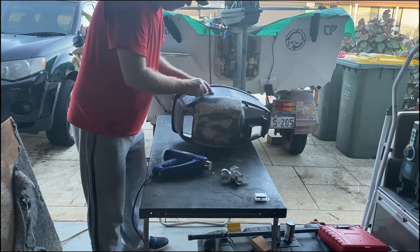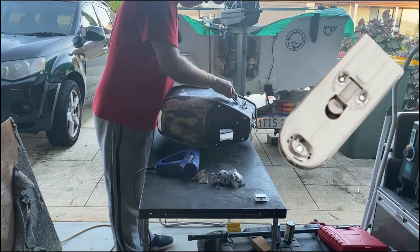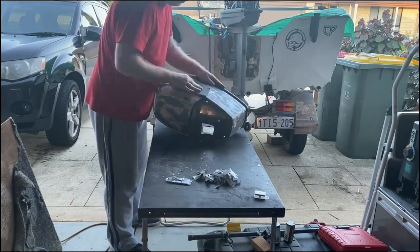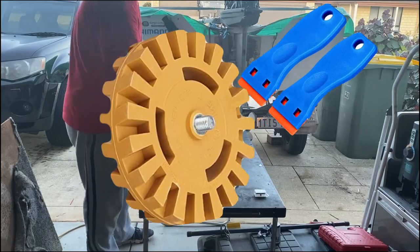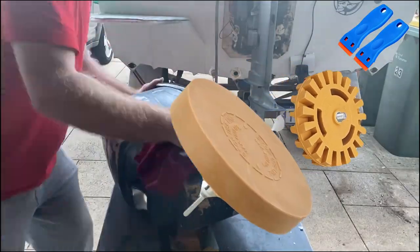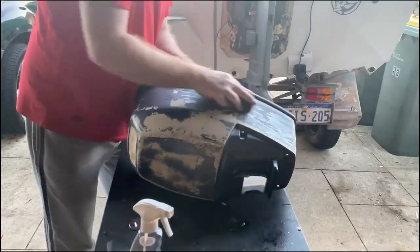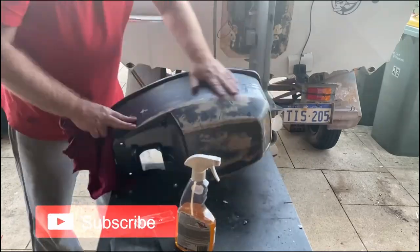The first thing you have to do is actually remove all the decals. Here I just used a bit of a hot air gun and a metal scraper and it took it off in seconds — the quickest way to go. Here are three other tools you can use: a plastic rubber scraper, a fluted caramel wheel, and a standard caramel wheel. The last two are quite expensive, about $50 each, so I would go with the rubber scraper, or like I did, the metal scraper was easiest. The spray I'm using is one of those orange citrus sprays just to help break down the adhesive.